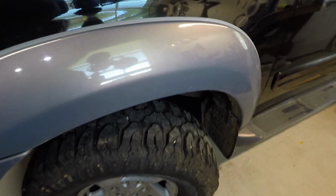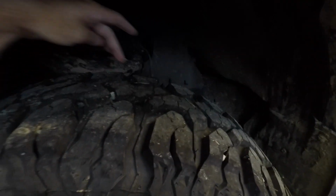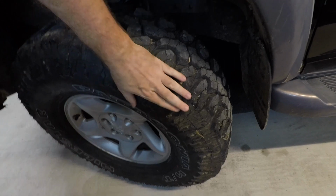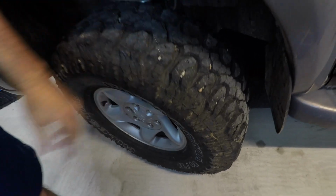And just to recap, while we're doing this, we're rubbing on the upper control arm on both sides, and it wasn't really that bad until I replaced the struts on it, and it made it sit like half an inch higher, so it rubbed all the time. To recap even further, when we put these tires on here, it's the factory wheels. These are 285 75 16s, and you can get away with this size tire if it's not a mud tire. But these tires have such big lugs on the side that they're rubbing the lugs on the inside. You can actually feel the groove in it right there. And the last few times I drove it on the highway, you come to the stop sign, you can smell rubber burning. So something had to be done.